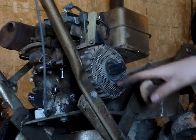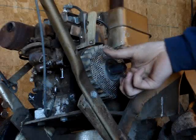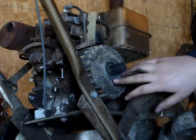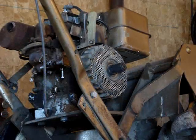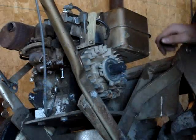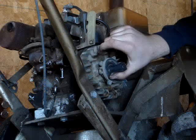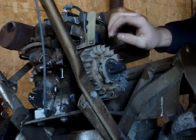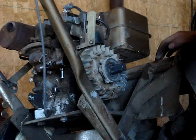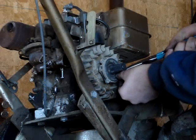I don't know if that just needs to be cleaned up or if the points behind here are bad. I also have to fix the overrunning clutch — it's going to need to be cleaned out and lubricated. We've got some little screws to take out there and we'll take that screen off. Now you have your overrunning clutch. They're threaded on here with regular standard threads, so you have to unthread them. What you need is a tool for the impact that'll go around these lugs and jerk it off. There's a snapper piece in here and I'm going to fix the overrunning clutch while I'm at it.